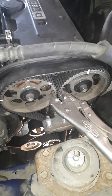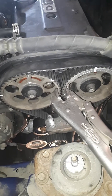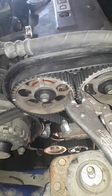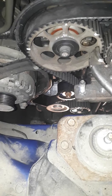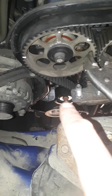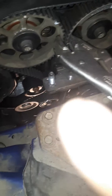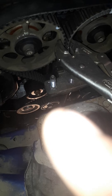There's another car similar to the Optra but with a different engine — same type of engine, but anyway. On the 2005 Chevy Optra, I just used vice grips to hold my two sprockets in place. The timing's pretty easy. To get the belt off I actually changed the water pump. There's that pulley right there — if you take that off, it'll be real easy to work with. Don't take off your tensioner down there; that's the tensioner. You just need to loosen it.